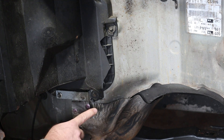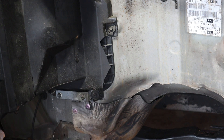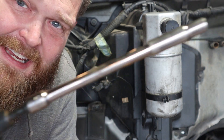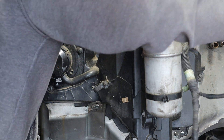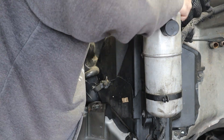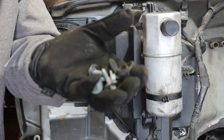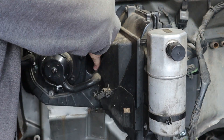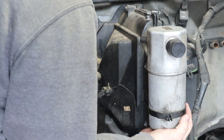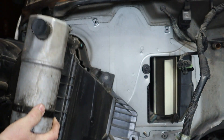Now we've got a nice flush fit. I chopped the stud before removing the nut so the nut would clean up the threads when threaded back. I've got an extension and a 10-millimeter and I'm going to buzz this off. Let's go ahead and unplug our blower motor and unplug our resistor. I'll put all the hardware in a safe place — and more of this old brittle plastic is just falling apart. That whole half just fell off; it was ready to go.